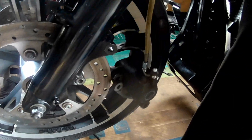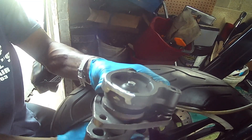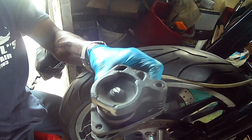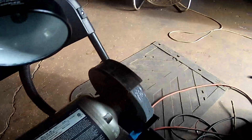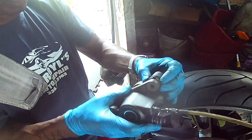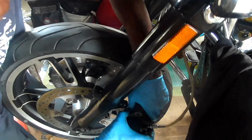I'm going to get my man Steve to hold the camera. What I had to do to modify this: you see right here - you have to grind this down, because it will hit this part of the rim. They've got these big intrusions sticking out, so you have to file that down. I used the wheel grinder right here to grind that down - didn't take too long. Once you grind it down, you've got to take your time because you have to pull it off several different times and get your measurements again.